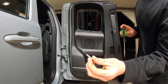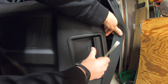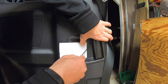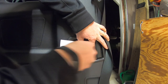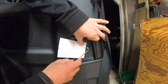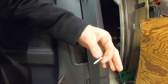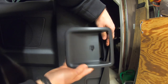Set that screw aside. Then over here behind the seat belt you'll see the door handle. Take your screwdriver and index card, carefully wedge it in, and remove the cover — you don't want to lose that little tab. You'll see another T25 Torx screw right below it. Remove that screw and then take out your door handle bracket.